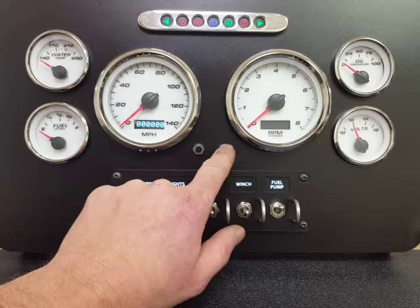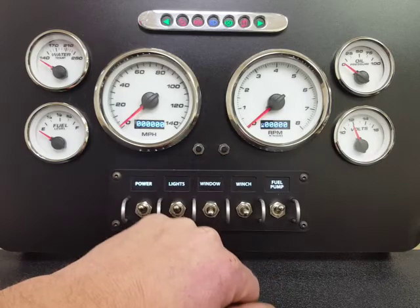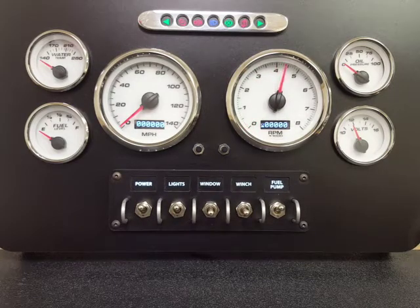There's also a blank screen if you don't want to see anything else — right now we don't have the input set so it is blank. Another neat feature is our shift system. We've got it set up for 6,000 RPM. At 5,000 RPMs — a thousand RPMs before the shift point — it will give you a single arrow. At 500 RPM before, it will give you two arrows. Then at your shift point it will light up 'shift,' telling you when you need to shift. All without any additional drivers, boxes, modules, or lights, so you get a nice clean design.